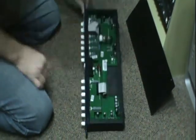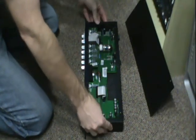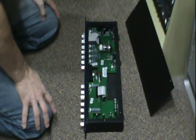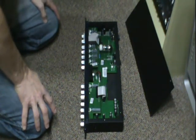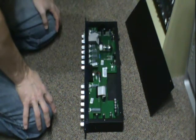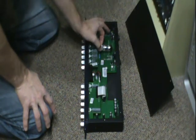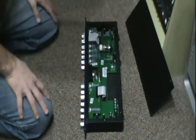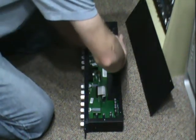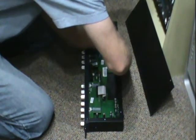Here's the tube. It's a good idea to put your hands on the outside of the chassis on the metal and try to discharge any static electricity so that we don't short the chips out inside. The tube is right here — it's not screwed in, it's pressed in. It's a very delicate socket, so you really have to hold pressure on it when you're trying to wiggle it out. All I'm doing is just wiggling it out, and there are pins in here that will just come loose.